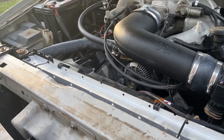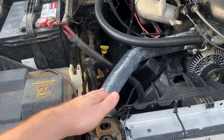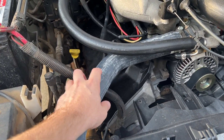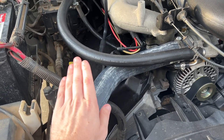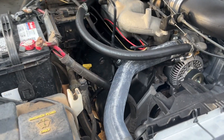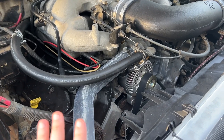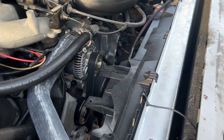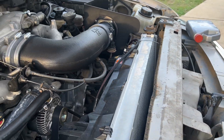Most of them are relatively simple and easy to diagnose. So I started with just the absolute basics. I thought I found that the heater hose here was collapsing under load because it wasn't the factory hose — it was intended for this Navigator-swapped F-150. I swapped that out, made no difference. Changed to a slightly cooler thermostat, made absolutely no difference. Then I swapped to the Raptor electric fans, got those wired in. That was a big task in and of itself.